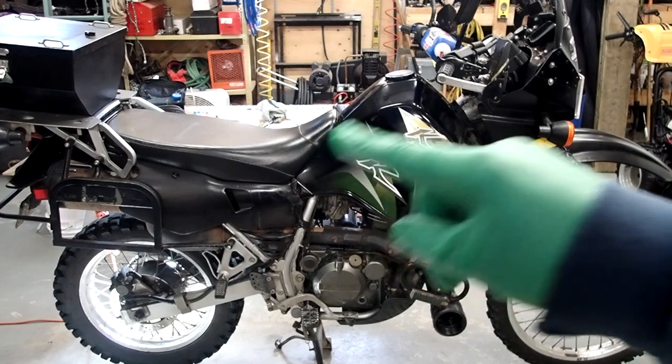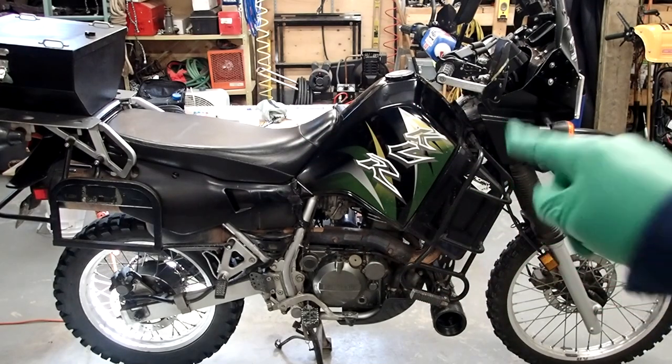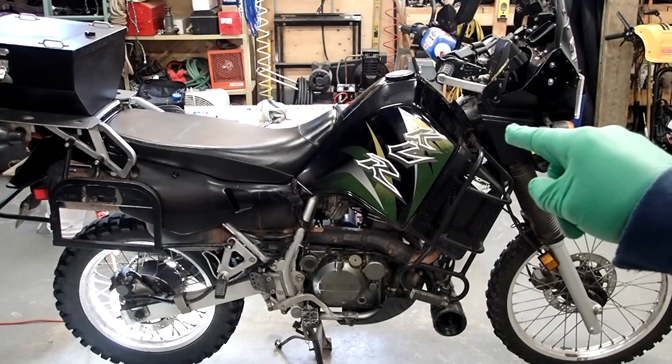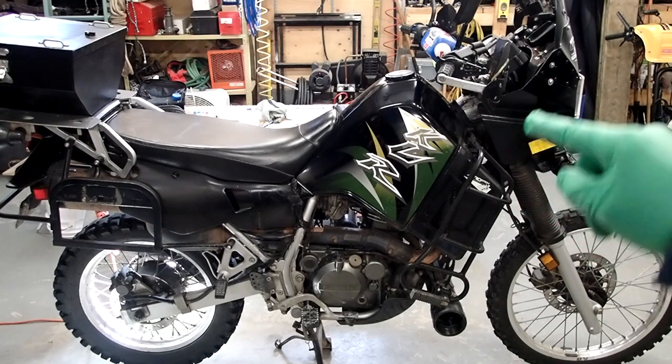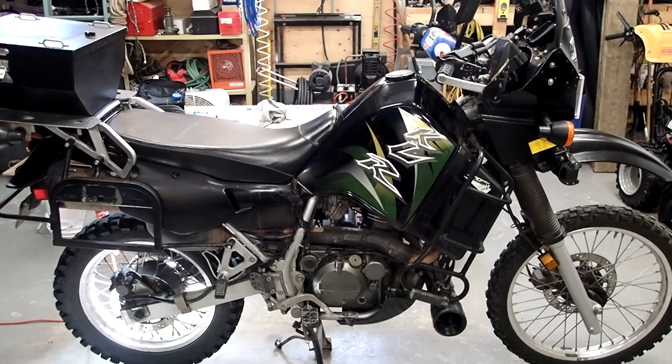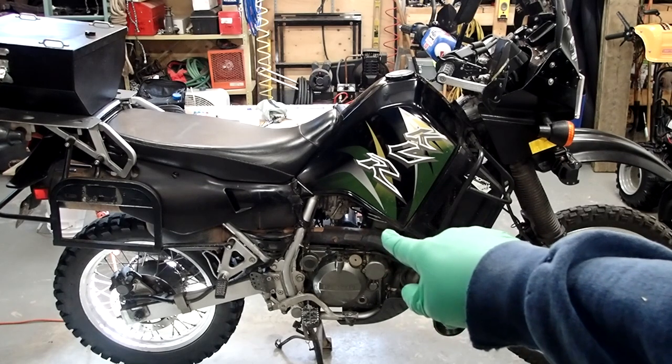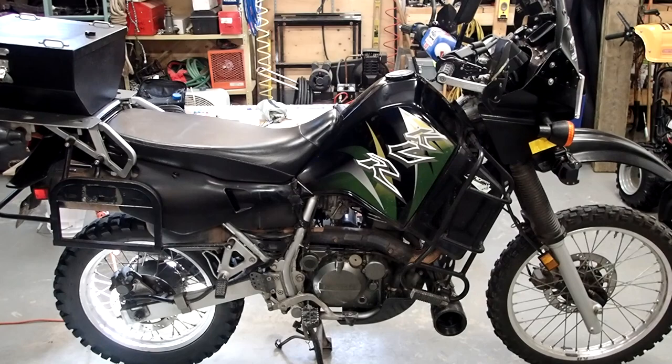So we've got to take off the seat. I've got to drain the tank, take the tank off. It's always good — we've got winter around here right now, so it's always good to keep the tank full so you get no moisture in it. It's a steel tank; plastic tanks are okay. So I'll take the seat off, side panels, I'll put a new air filter in there, just generally make sure everything is good. Change the oils — I did the fork seals last year.